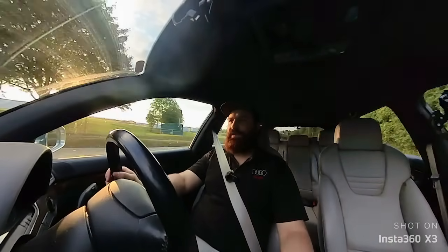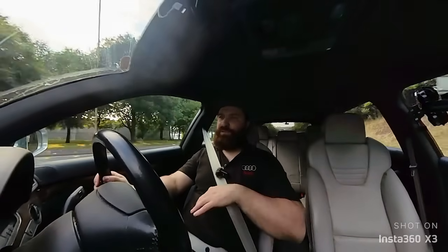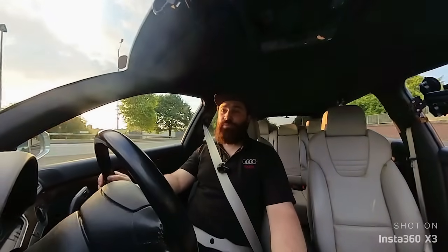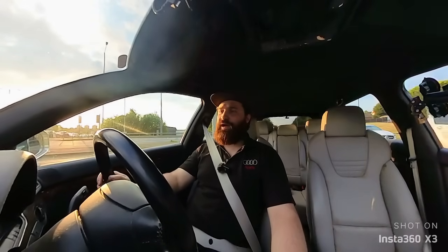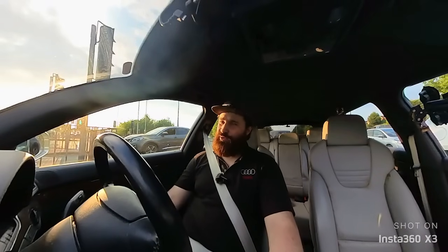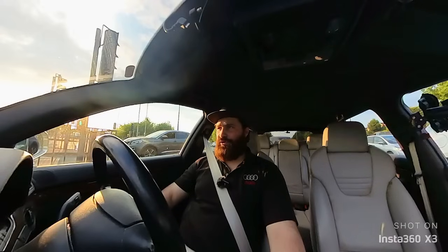In this case the bill was around £8,000 because we did the suspension arms, the flywheel, the clutch kit, the whole timing chain, camshaft adjusters, water pump, the whole middle of the V was resealed, and the hoses. The hoses are a bit of a problem as well because you can't get them anymore and you have to improvise from aftermarket universal parts — because of all the oil leaks, the hoses are falling apart, growing in width, and the clips can't hold the coolant system pressure, so they start leaking around the clips.